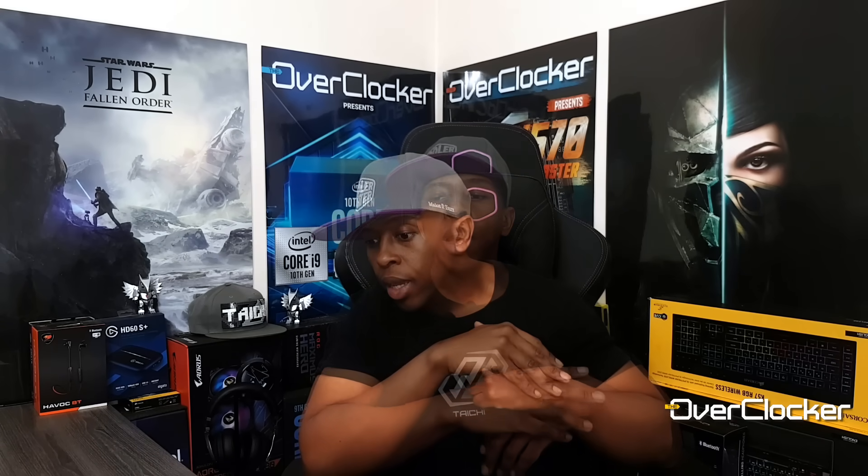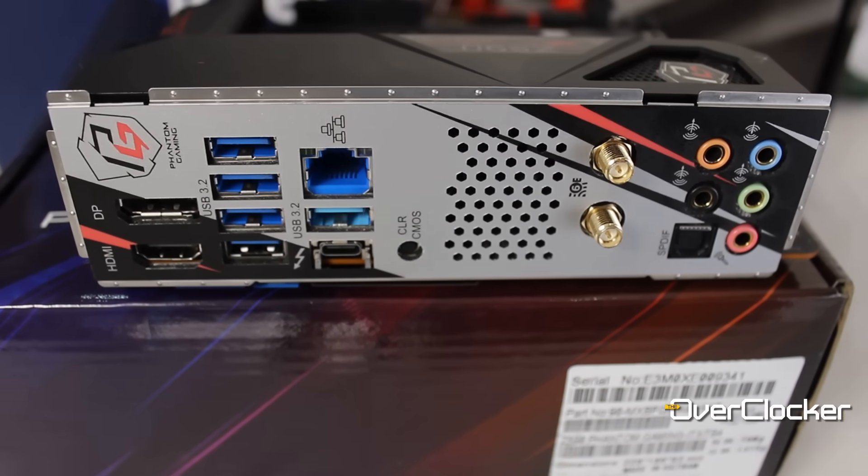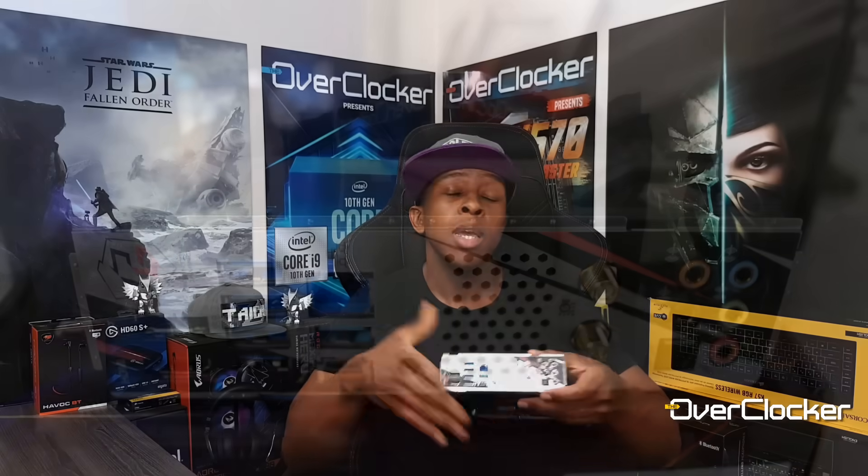We've spoken about memory OC. Overall, I'm happy with DDR4-4600 performance running CL17, though I would have liked to explore DDR4-4800 or even 5000, especially using Gear 2 mode. Something pretty interesting: this internal USB 3.2 header is actually Gen2 X2, giving you 20 gigabits per second instead of the 10 gigabits other vendors provide. The light blue USB 3.2 port on the back IO is also Gen2 X2. And as the name implies, this board has Thunderbolt 4, or USB 4.0.